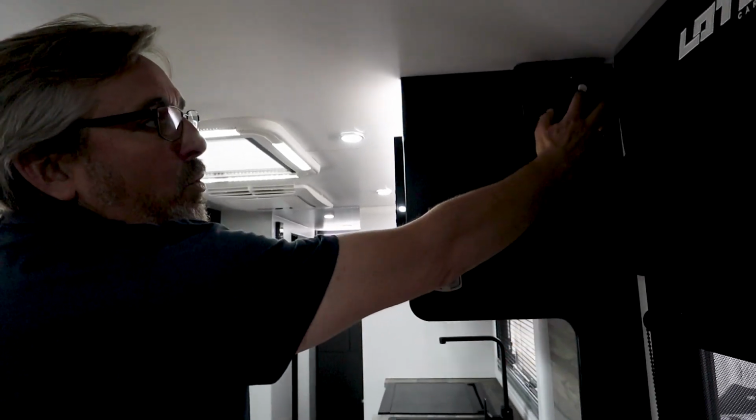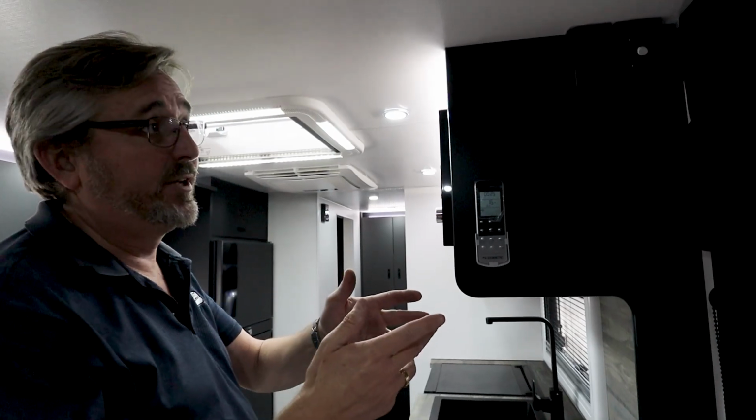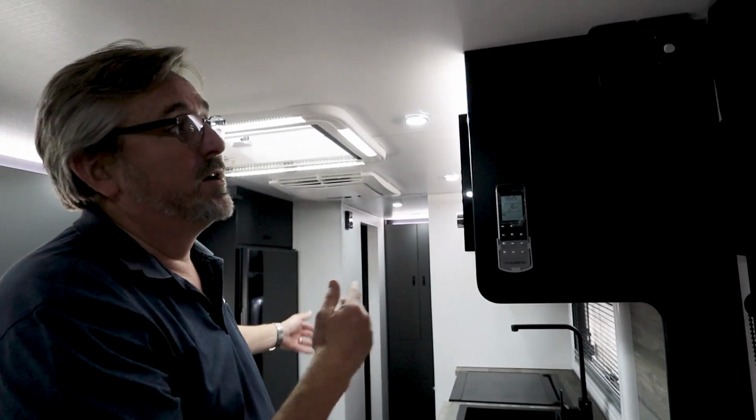All right, Tom, now we're on the inside. In Mick's wonderful world of splicing and dicing, this will be seamless. The white one is your 12 volt isolator. If you turn it off, everything 12 volt turns off. You can use it as a walking away from the van. It'll turn off your lights, your radio, stuff like that. If you're free camping, no, it'll turn off your fridge. So be aware of that.